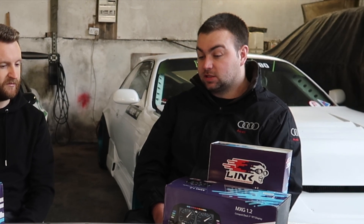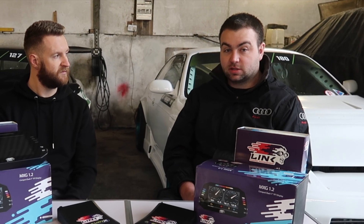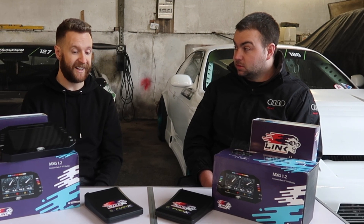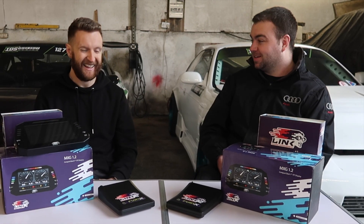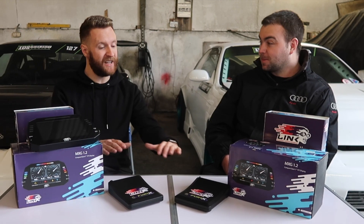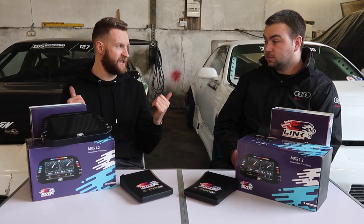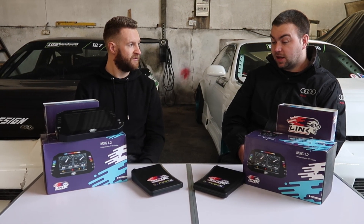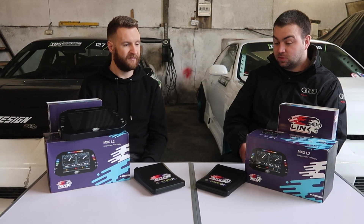It has the same spec and more than the previous Link Extreme, and this actually has built-in wideband oxygen control — your wideband oxygen control can be handled in the ECU instead of needing an external controller. This ECU really does best suit a 6-cylinder: it will do six ignition drives, eight injector drives, and it will do sequential injection and direct spark for a six-cylinder. It will take two knock sensors and two trigger inputs from a camshaft or crankshaft — so it really is best suited, an absolute top-range ECU for a six-cylinder, ideal for the RB in your car. But just because it's perfect for a six-cylinder doesn't mean we can't adapt it for our SR20s — it's actually going to be properly overkill for our SR20s. These are universal wiring ECUs; you can literally wire them to whatever you want.